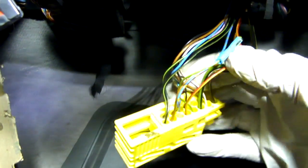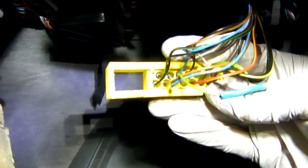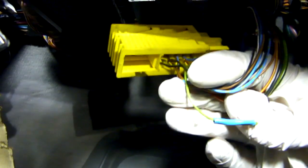I cut pin 66 wire and used some heat shrink tubing to cap both ends of the wires off — here's the other one. I'll put some electrical tape on it to make it look neat. With this modification we just did, we'll be able to run any 413 ECU and any aftermarket performance chip that has no EWS coding in it. I'll plug it back into the EWS module and then we'll do a test fire.